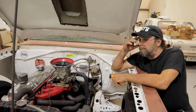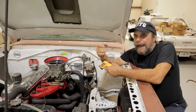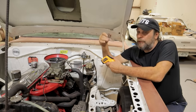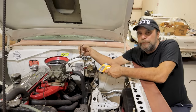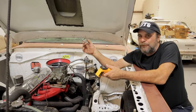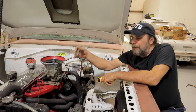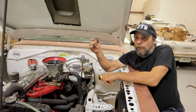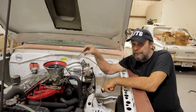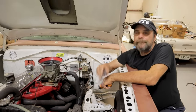Interestingly, I didn't think it was going to boil the way it did at 150 degrees — I figured maybe 175 before we'd really get action. But it just goes to show you how low the temperatures are when you're talking about vapor lock and fuel percolation in the carburetor. It's interesting to see exactly what temperatures we're dealing with, because 150 degrees is nothing, especially to an engine that's in traffic with the hood closed — it's really easy for the intake system and carburetor to reach 220 to 250 degrees, and at that point everything is just churning. I hope you got something out of that. I hope we get results — and if not, we go back to the drawing board. I'll see you tomorrow.